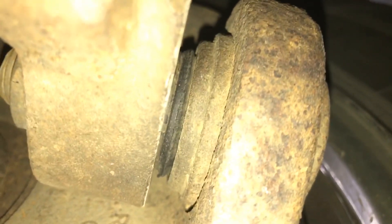Can you see it moving? Let's check the top — touch it to one of them, see it moving. It's the axle actually moving on the ball joint. You could argue the upper ball joint is a little bit — just minute movements. If you lift it up by there, sometimes — I mean that's not catastrophic at all, but it's not tip top.